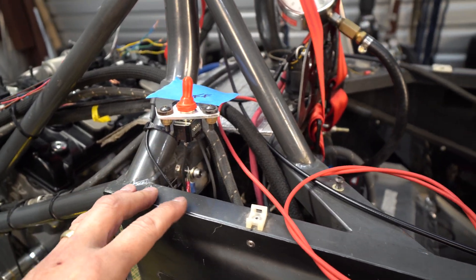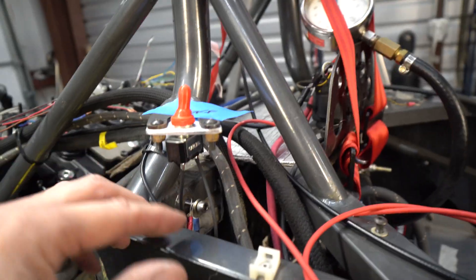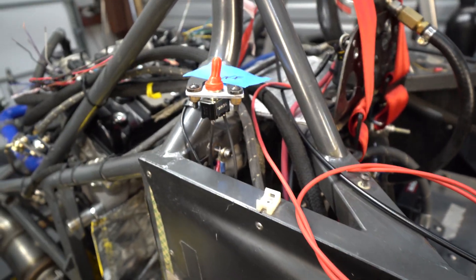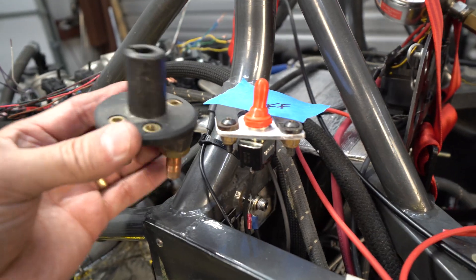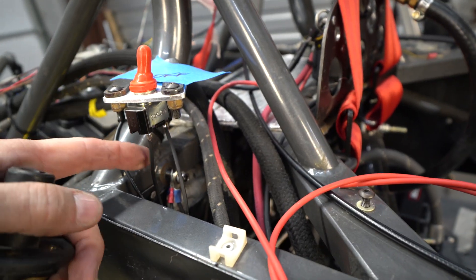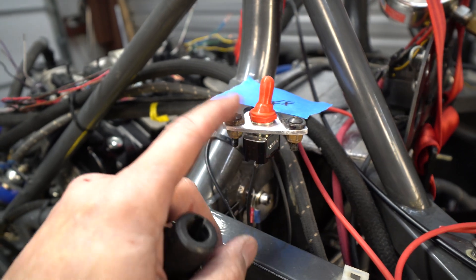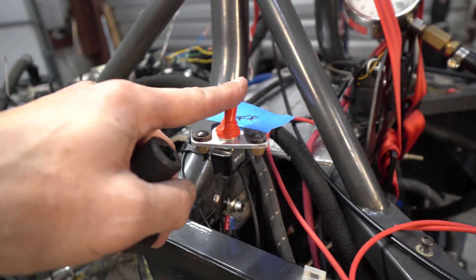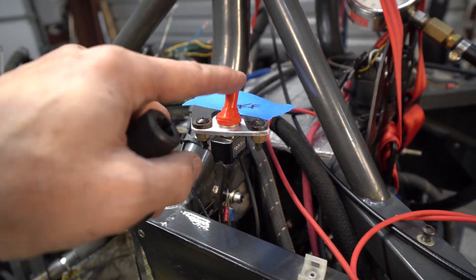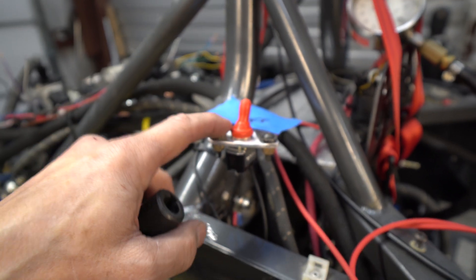So I'm just wiring the car up here, it's a little messy, but you'll see this small little single toggle switch. This replaces the old mechanical switch that I talked about. This is connected to ground and then has a lead from it directly to the solid-state relay. All you do is pull this — you don't have any power energized through here. It's fantastic. The requirement for external on-off control is actually there.